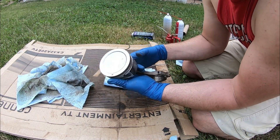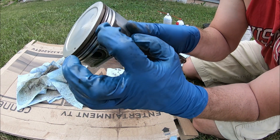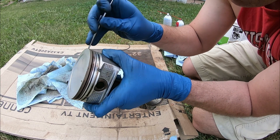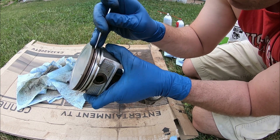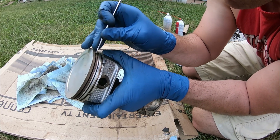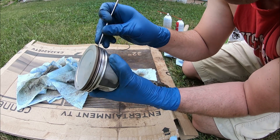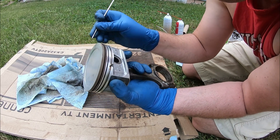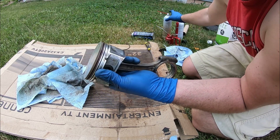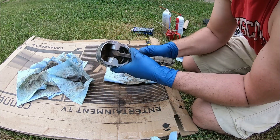After a lot of scraping I got it pretty clean. That second groove seems like it's the worst — the top one seems a little easier because I think it's not baked on quite so bad. The oil ring is pretty easy to get out because it's bigger and you can fit more tools in there. The top ring seems pretty easy to clean; it's that second ring that's really the issue. So yeah, it's pretty clean.